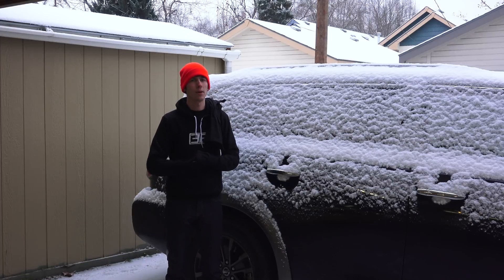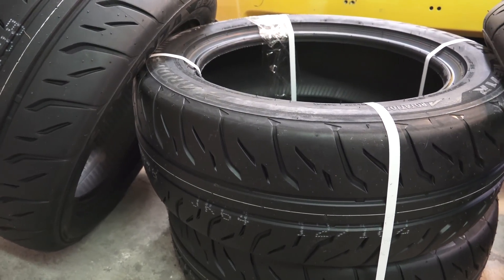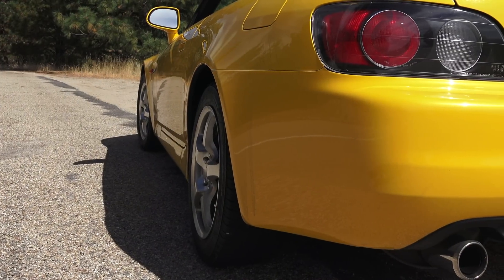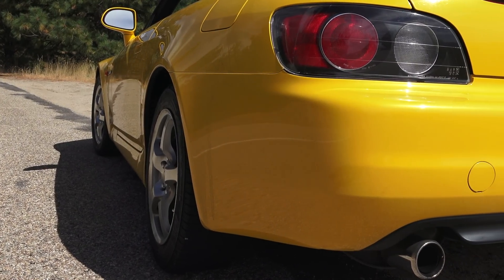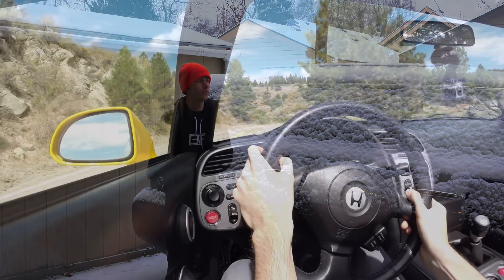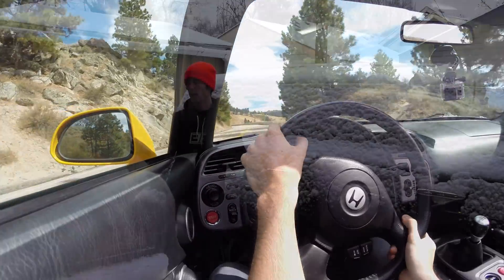After that I can start to get into the modifications. I want to do new tires, and I've got to change the alignment — the rear alignment is way out of whack, there's super high negative camber on there. I want to fix that and make sure the alignment is all to spec, get it back to factory settings. It's got those $50 tires on it, so it obviously needs new tires.